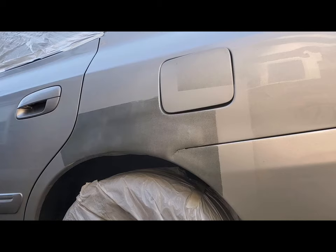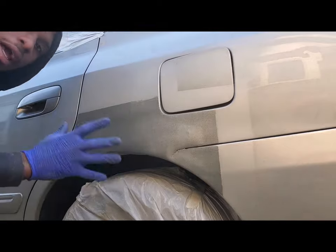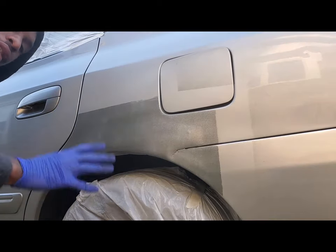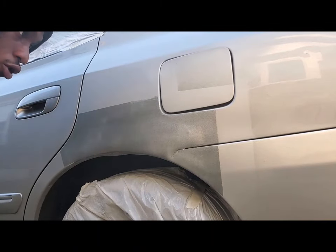Okay. So always go light first, because really you're just setting a nice base before you go ahead and put the next part on. And see, the light base acts basically like another primer. It brings the next paint to stick better. So this is where we are.